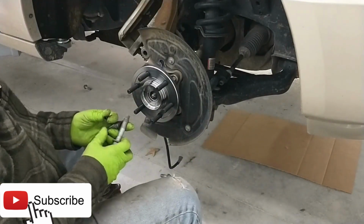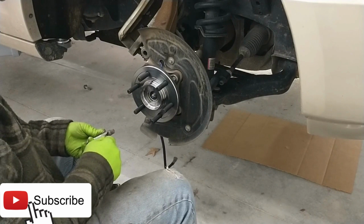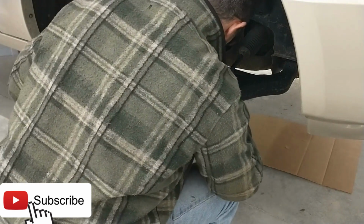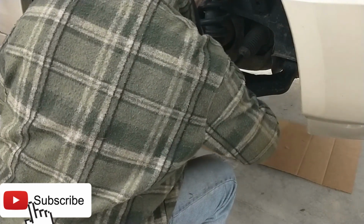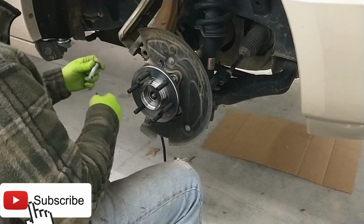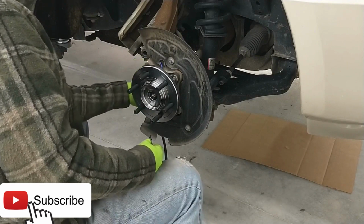We're going to draw it in here in a minute, but first we're going to pull those hubs, the four-wheel drive hubs, in using the vacuum of the engine, because whenever the engine is running on one of these Fords with the four-wheel drive, the four-wheel drive is disengaged. The hubs are pulled back. So we're going to start it up and let the engine vacuum do the work for us. That way you don't have to have an extra tool, vacuum pump or something to pull that thing back.